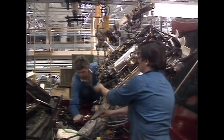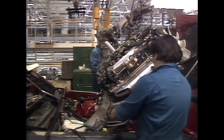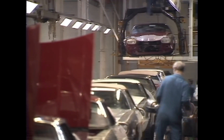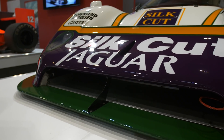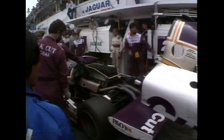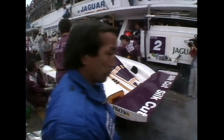What you can't see is the engine, which is the impressive thing — it's got a road car engine, an off-the-shelf V12 Jaguar engine. It started off at six litres but we gradually bored them out to seven litres. The best engine was the seven-litre. We also did a 7.4-litre: at seven litres you have 700 horsepower, at six and a half litres you had 650 horsepower, and the 7.4 gave you 740 horsepower.